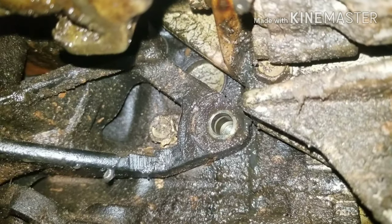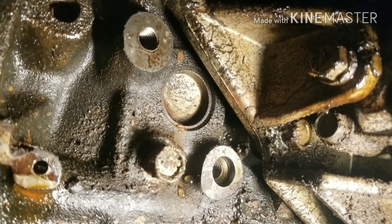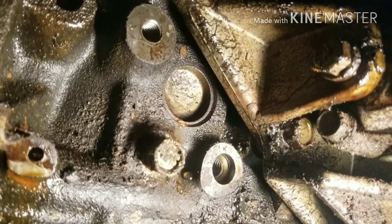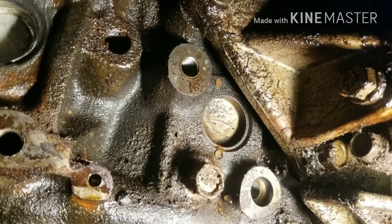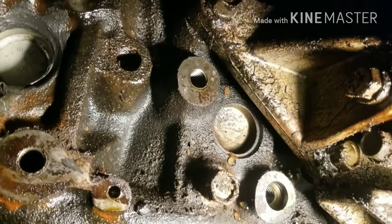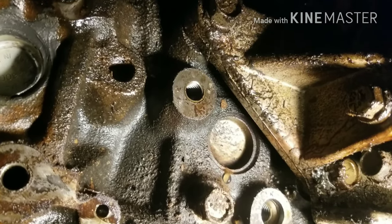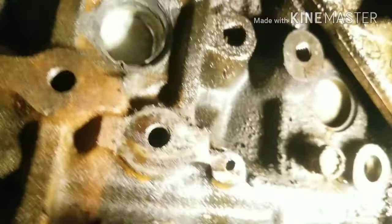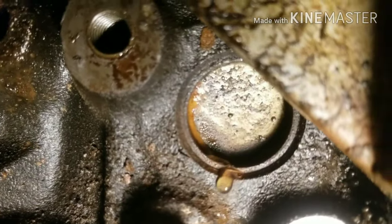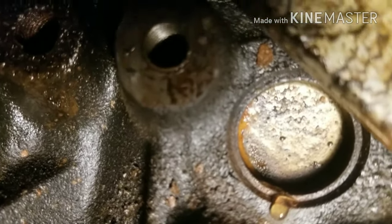I wish I could get a little bit closer, but once we get that bracket off you can see a lot better. Now that we have that brace out of the way, you can see how the coolant is just seeping out of that freeze plug there. So what we're going to do — they've already replaced this one, somebody's replaced that one — but on this one I'm actually going to use the screw-in-type freeze plug. I'll knock that one out, get the size, and then I'll show you the screw-in-type freeze plug. It makes it a lot easier when installing. There's a closer look at that freeze plug — you can see how the coolant is seeping out.